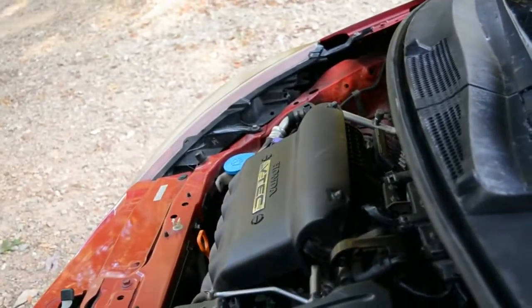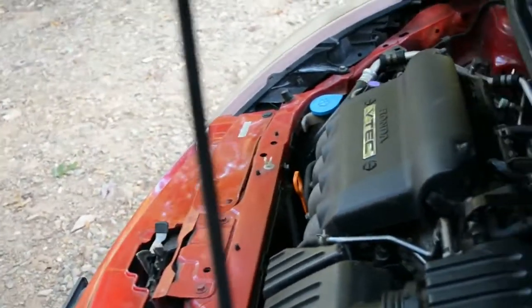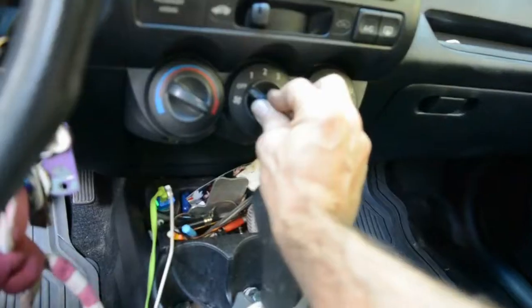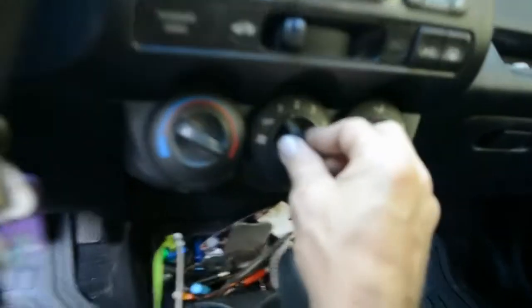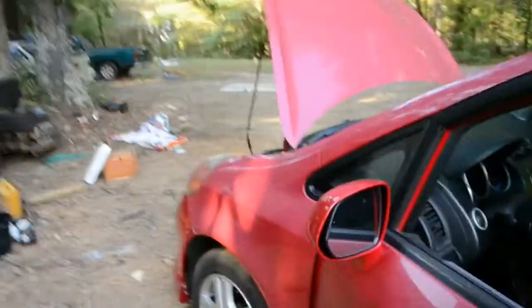...that's a good sign the sensor has gone bad. Here's an easy way to check if both fans are working without unplugging anything: turn your fan to on, then hit the AC. Both fans should turn on. Go up to the fans — be very careful — and put your fingers behind them to feel if air is coming from both.